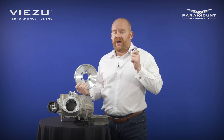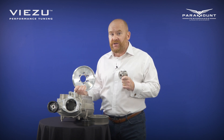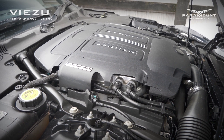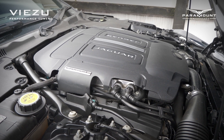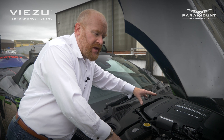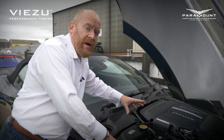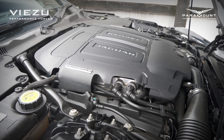I've got a couple of sound clips to show you now of a supercharger that's not looking quite so healthy — these are the noises you want to be listening out for. Can you hear that kind of slightly rough sound? That's what we're listening to, and that is your main supercharger bearings becoming noisy. At the moment the engine is cold; as it warms up that noise is going to get quite a lot louder, but it's there all the time as a sort of constant background noise.